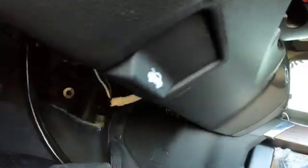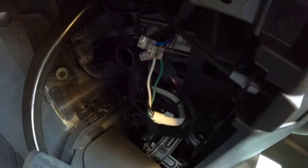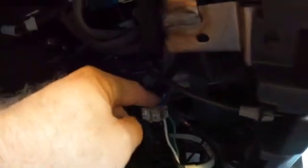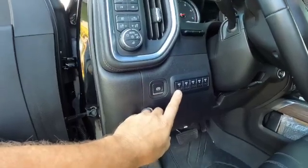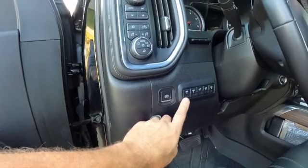Now you'll notice underneath here, this is where I've wired everything together. So for me, I found that the blue wire, which is this one right there, that blue wire, that's connected to my white, so that goes to my pump. The blue wire is number 1. And number 1 is a 25 amp, which is what you're going to need to operate the 20 amp pump.